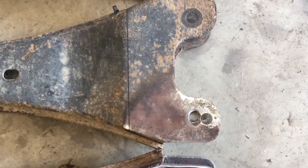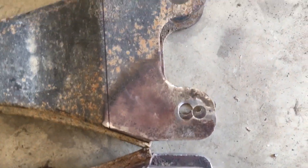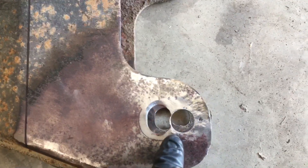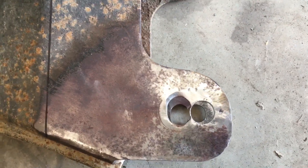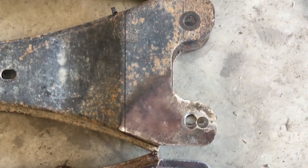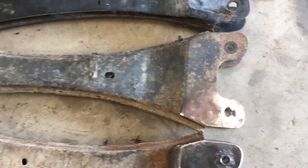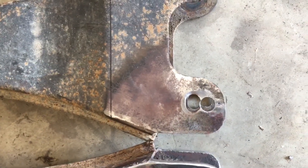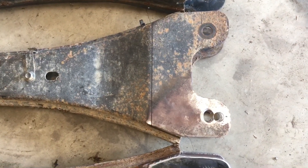I have one completely completed and one that I'm working on. What I had to do is re-drill the lower hole because my caster angle is different — my radius arm is tilted up differently than factory. So I had to move the centerline of this forward. On my particular application — yours could be different — mine was 690 thousandths that I had to move it forward.